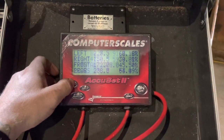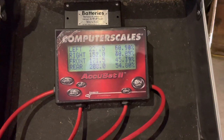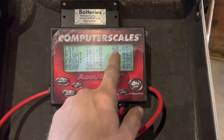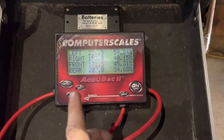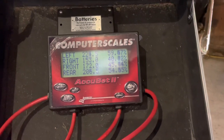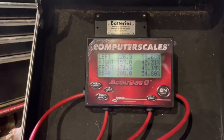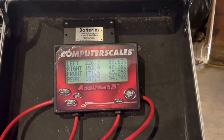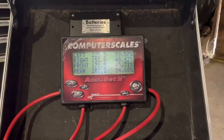To get more accurate, we're going to look at percentages. When you go to your manufacturer's website, they're going to tell you what they prefer for nose weight and left side weight — those are usually the most common. My nose percent is 45.3, which is probably a little light, but again this isn't a real scale session — I didn't even set my tire pressures. This is basically what you're looking at though. Make sure your scales are labeled: plug left rear into left rear, right front into right front, or you're going to be very confused. I don't want to say how I know that.